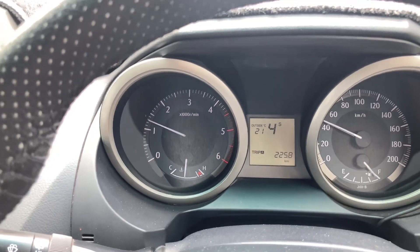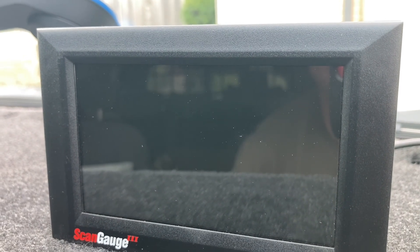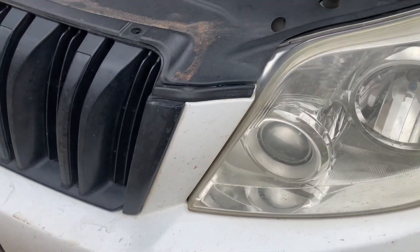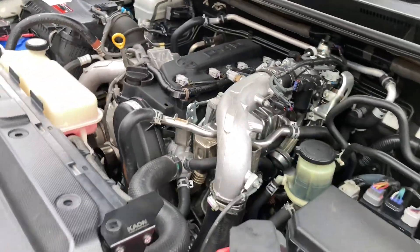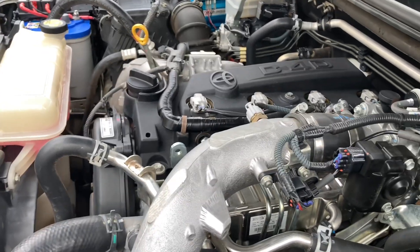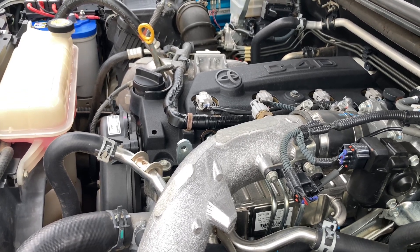I've shown this also in the 120 Prado in the VIP group in some private videos. These scan gauges — you can set the alarm, like the voltage alarm you can see here, and you can also set coolant temperature alarms of course. The variables are going to be: how much bugs, dirt, and debris have you got jammed in your radiator? Is the radiator clean? Have you got a bull bar, lights, and the speed you're travelling at? Draw a circle around 83 — that's about normal, so 81 to 85. It's going to stay pretty consistent when driving in peak condition without modifications. In hotter temperatures, once you get into your 30s and 40s, you're going to see a few degrees more.